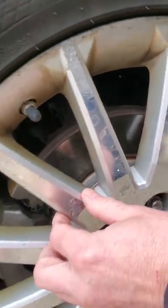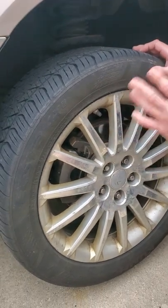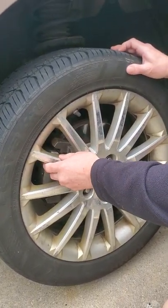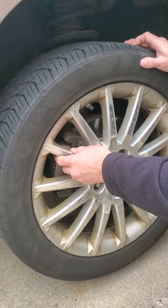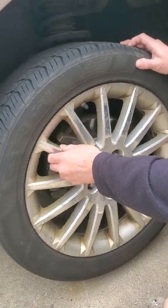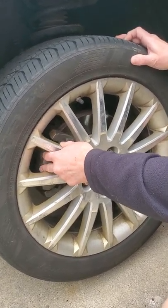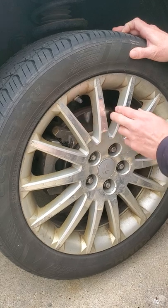If you can see this brake right here — see this heat mark? What happened a couple weeks ago is I'm driving the car and I really got the strong smell of brake dust and brake pads, and I jacked the car up and this would not move. It was completely frozen. So I went ahead and replaced this caliper, and now everything's fine, but if I'd have done this initially at first, I would have seen that the caliper was gone, and I wouldn't have replaced these rotors about six months ago.